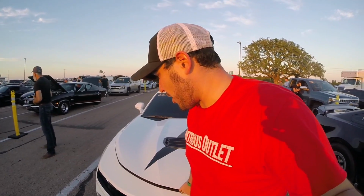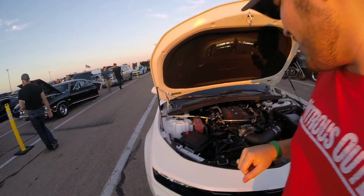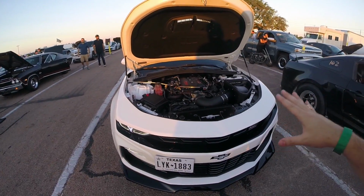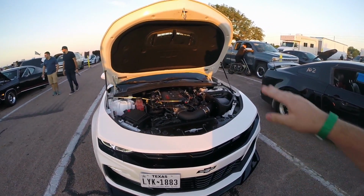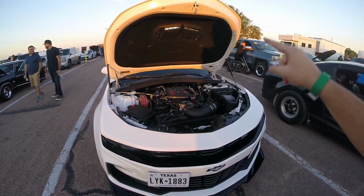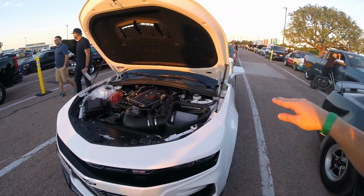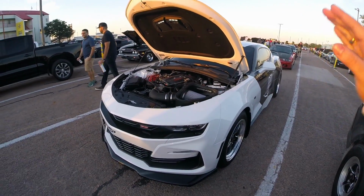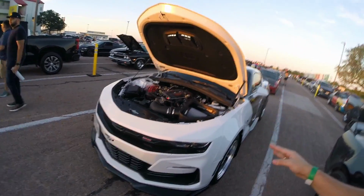Now we're gonna try one more time. The track seems to be prepped really well, so it's hooking, it's doing well with the 50% off the line. We're spraying it at 2400 RPM. We're gonna bring that down to 2300 RPM, keep the same 0.7 second delay, and see if that'll get us where we need to get. And hopefully the car runs good and we can see a 9-second pass. If not, then at least we know we're very, very close.